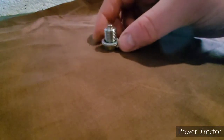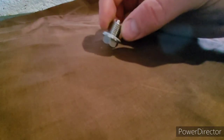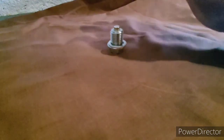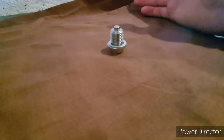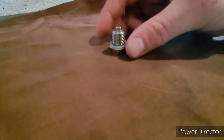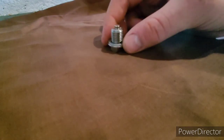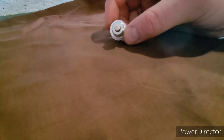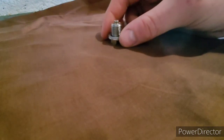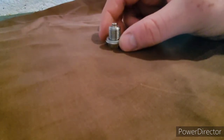The reason being is it's a brand new engine. Engines require a bedding-in period, so even though the bearings are all sat perfectly, you're going to have some form of metal filings or metal particles — however small, micron-wise — being discharged from various parts of the engine. They end up in the sump, come through the strainer, into the filter housing, and then obviously go into the engine. What I don't want is any bits of metal getting anywhere else other than stuck to this.